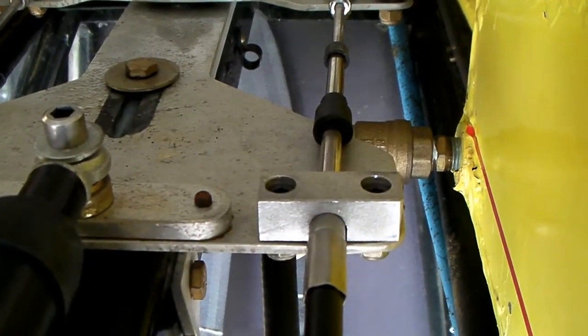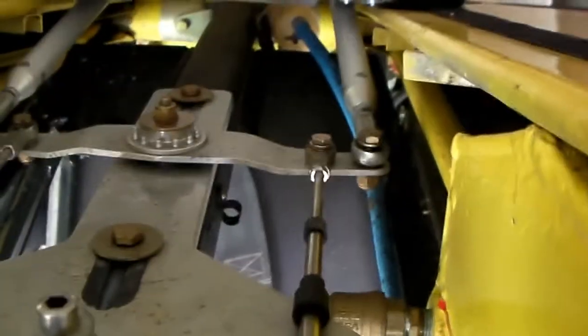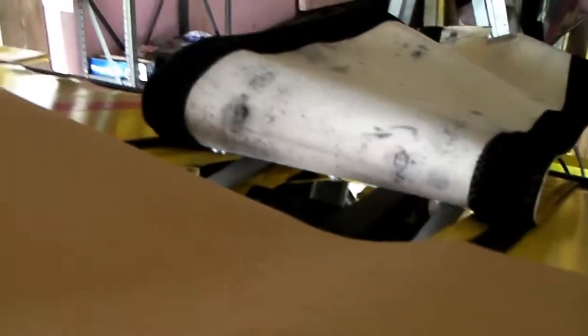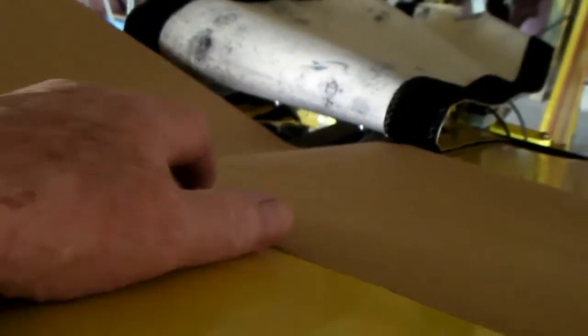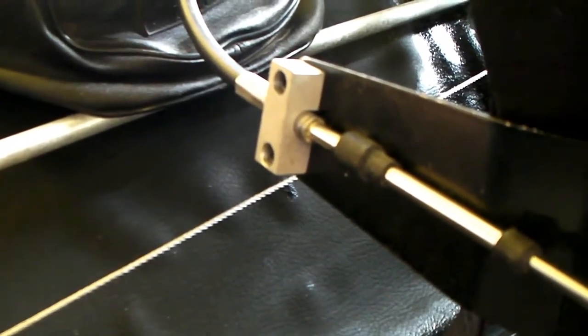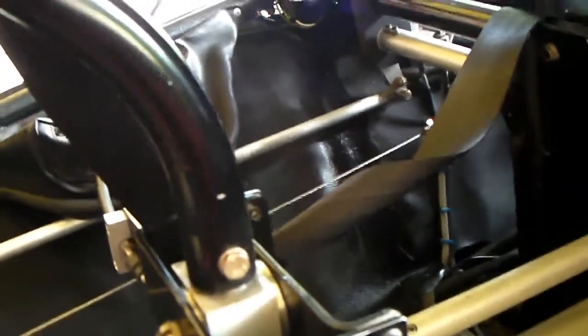Here's what my cable end clamp looks like, and this is the sheet metal version for comparison. This one comes from the front stick and this one's the rear control stick. You can see how they hook up and push on that bell crank to work the ailerons. To get the cover over the velcro I put a piece of paper across it, which lets me slowly work my way up without the velcro sticking. When it's positioned right, I pull out the paper. The rear seat cable and control stick work nice and smooth, but it's only about a foot long — maybe less — so you don't have as much mechanical advantage as the front stick, which is probably another foot longer.